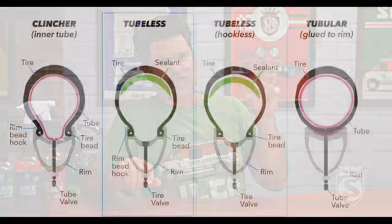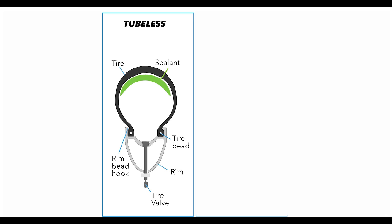Number two: the install and removal of tubeless tires. There's a lot of stuff we were taught back in the day with tubes or tubulars that doesn't hold anymore in this tubeless world. The big one is the orientation of the valve when installing and removing. Looking at a cross section of the tubeless rim, there are two shelves where the bead sits with a little bump to lock the bead in — that's the popping you hear when the tire beads up. Those lock buttons keep the tire from creeping into the center channel if you have a catastrophic pressure loss, but that channel is there to help you install and remove the tire.